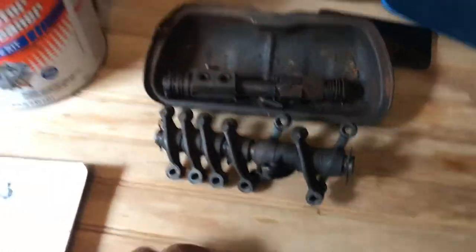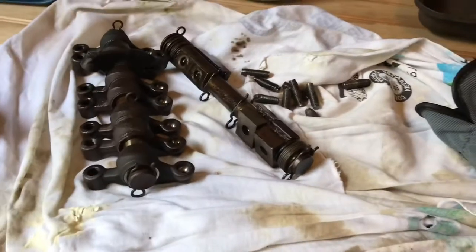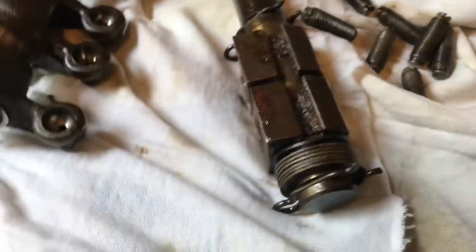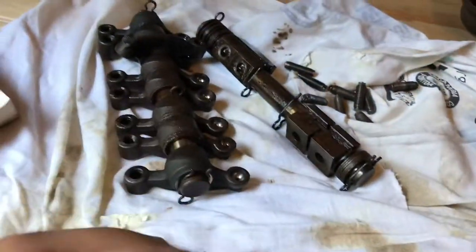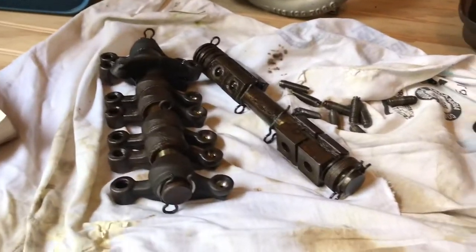Pretty much the first step is to open this up, let these soak in there, and I'll get back to you guys after. I'll let the rocker arm soak in the solution for probably about 45 minutes each piece — all the adjustment screws together. Everything seems to be going pretty great. What I'm going to do next is clean all this gunk off. You can see all this gunk here — it should come right off. That solution basically works the same as leaving your dishes soaking in hot water, which makes everything easier to clean. Anything that's on here will just come right off.